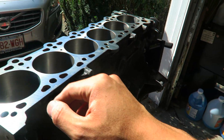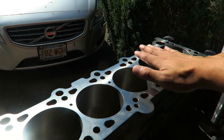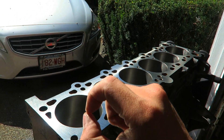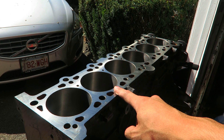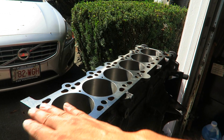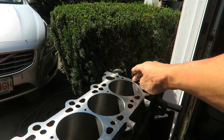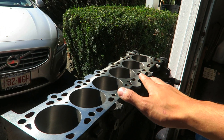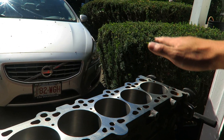Apologies for any residue because I was taping this off to clean up the side a little bit. Essentially, at Malden Machine they decked the entire block — by decking I mean they resurfaced it, grinding off no more than two thousandths of an inch from the top surface. The block was actually in really good condition. What they do is take one side and square it off to make sure that both ends of the block are not off by one thou or two thou, whatever they need to do to level it.